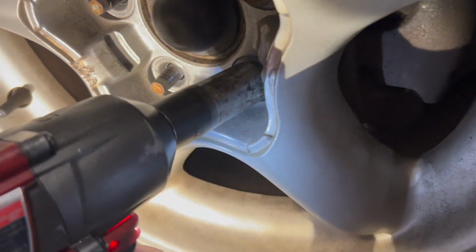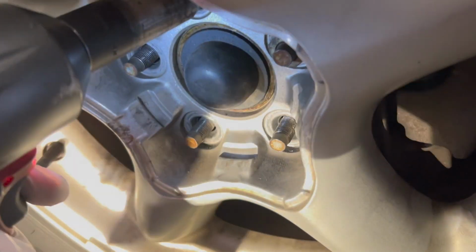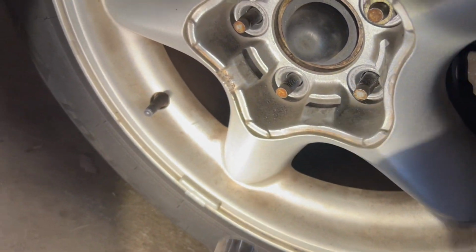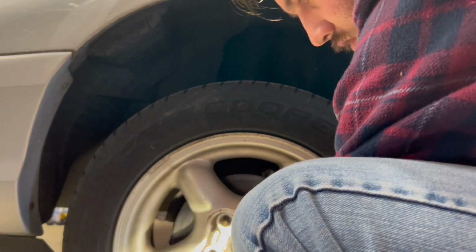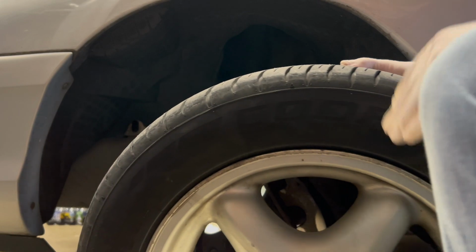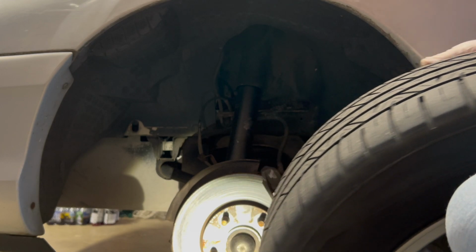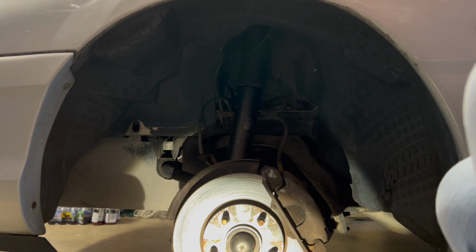All right, let's just take them all out on video, why not? I'll put the phone down for the last one, since the wheel is most likely not rusted on the hub, the wheel's going to want to fall forward. I don't want to mess it up. Sometimes the wheel will be real rusted up, especially on these older Mustangs. If you haven't taken the wheel off in a long time, it'll be seized up around the hub. So just keep that in mind when you go back. You may want to clean this surface up and the mating surface on the inside of the rim.